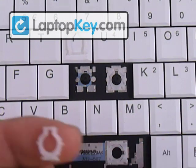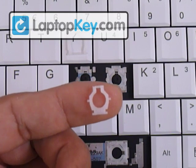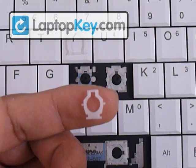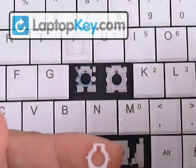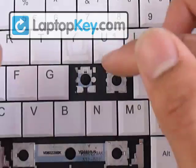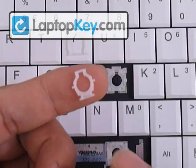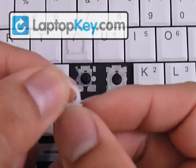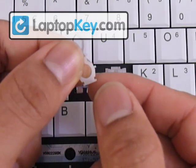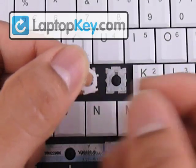Then you get your next piece. The small hinge has two pins at the bottom — those are going to click onto the keycap. The pins in the middle are going to go into the holes that are in the middle of the large piece, and the top bar is going to go underneath the large hook. Make sure not to put this piece upside down either, by looking or feeling the bottom bar. If it's smooth, that faces away from the keyboard. If you feel a gap or a thinning piece in the center, that faces and touches the keyboard.